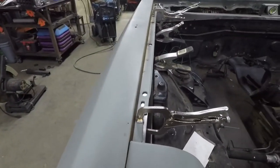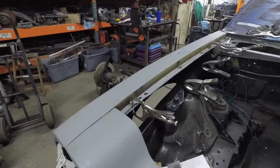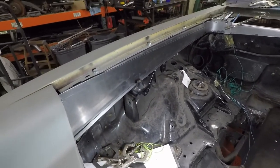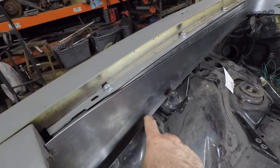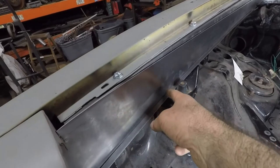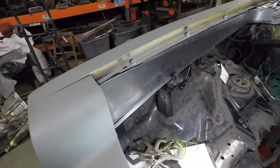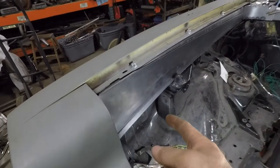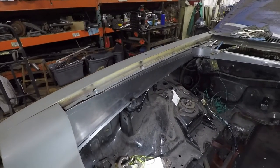The biggest thing is the Miata kind of curves in like this, so I'm going to sit in a design chair for a while and figure out the best way to do this. I made the bottom strip wider so I can overhang it a little bit, and I cut some panels to fill in between — there's a panel with a 90-degree bend and a flat bottom panel. I'm going to tack the bottom panel to this piece, and once we get all the sheet metal finished and everything lined up and square, I can trace this and come back and butt weld the pieces together.